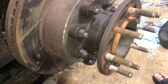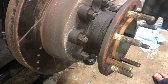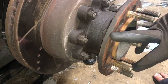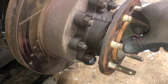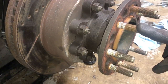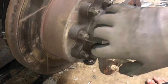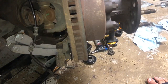After that, I'm going to clean these studs up quite a bit — they look rough actually. I'm going to get a wire brush, clean these up, get some pressure grease on here, and get this good to go. I'm going to clean these up with a wire brush and get them well lubricated so I can get the lug nuts on later. I'm not going to show you the caliper mount and caliper being put back on here — if you need that, rewind the video.